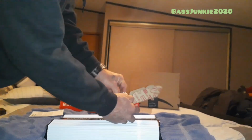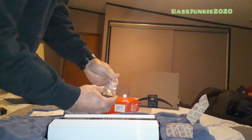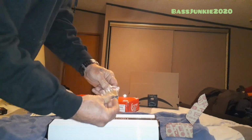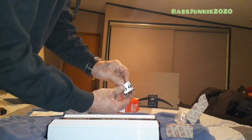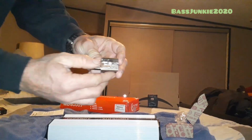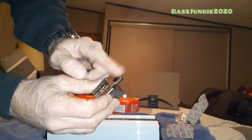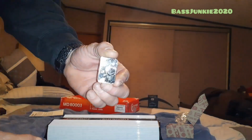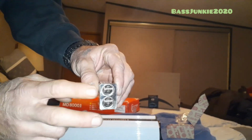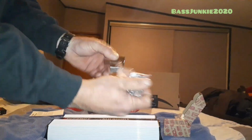They're dual 0 to 0. They're pretty nice. They're heavy. That little box they're in, I could tell they're good quality from the weight of them. So get it out of the bag. Big Allen keys. You probably put 2-aught in that. Looks like DS18. Nice stub on them. Flat on top, round around the sides. It's nice and round. This will fill up the hole really good. This is gonna work perfect. Dual inputs of 2 0-gauge welding cable into that should be sufficient for ground and power because there's two of them.